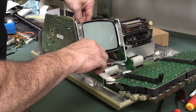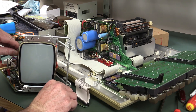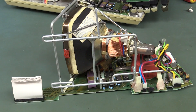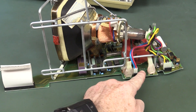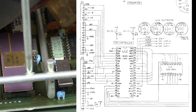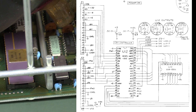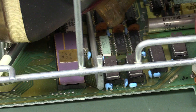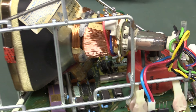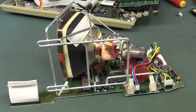I'm going to lift that out. Have they left enough room? You betcha they have! Look at that — that is beautiful system design that you can get in there, access, and repair everything. That is the complete module, it just comes out. The only thing attaching is the brightness control. You can see the digital interface coming from the processor through those two ribbon cables. We've got a graphics processor — the CRT display driver. All in one modular frame. Be easy to test at the production stage, easy to replace the whole thing — this is not by accident, this is by design.